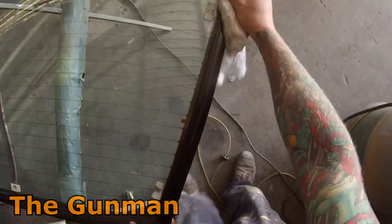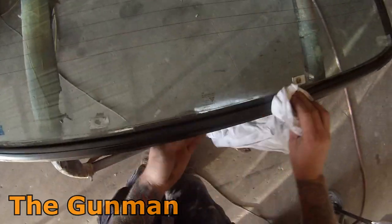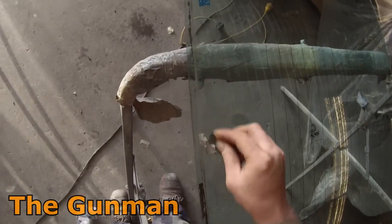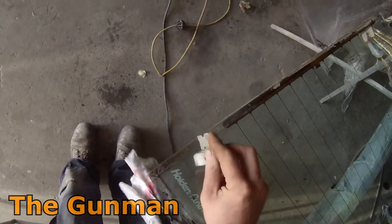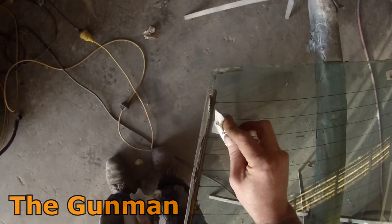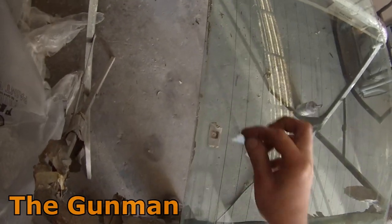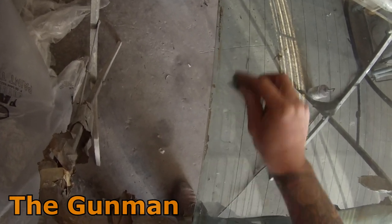Back on to the reinstallation — now the car's painted. First step is to just get a thinners rag and clean up the rubber so that it's nice and clean before it goes back in. You could use a bit of prep sol or wax and grease remover, any sort of solvent that's just going to clean that rubber up. Next I'm going around with a razor blade on those bits of glue that were gluing on the sunshade, which I don't think I'll be putting back on this car. Clean all the edges up where all the dirt has accumulated underneath the rubber, flip it up, and I'll be cleaning the inside just with a bit of Windex and a clean rag as well.